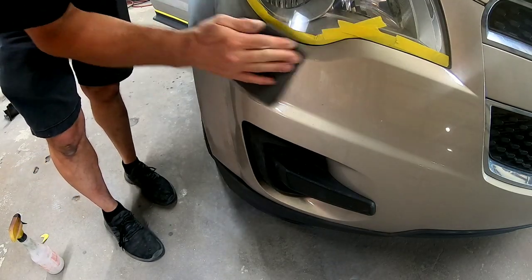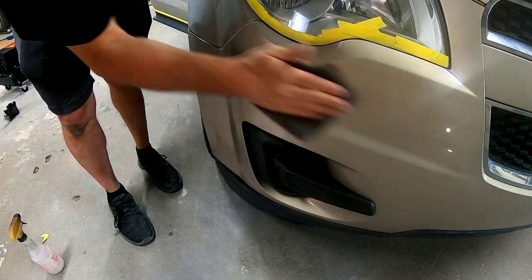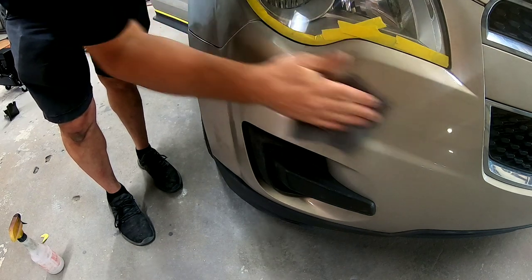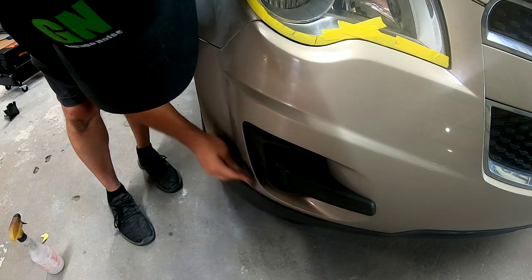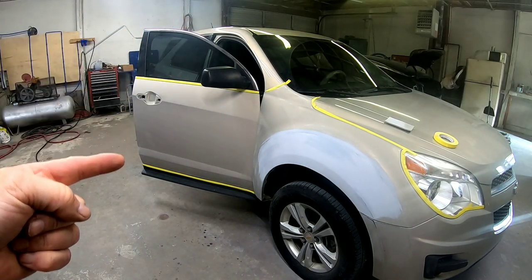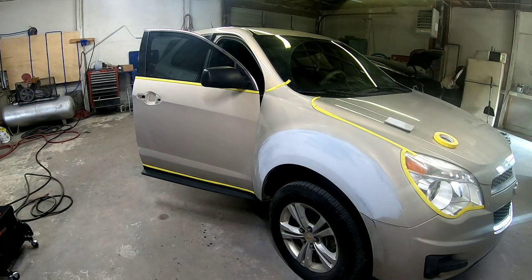Now I'm preparing this bumper for the clear coat blend. I've sanded the edge with 600 grit — that's where we want to do the paint-to-clear blend. The rest of it I want to sand with 1500 grit, and that's where we're going to end the clear coat. Then we'll wash it in with some reducer. Now it's time to mask it off for paint — we'll start by masking off the open door, putting a piece of tape on the back edge of the door and shutting it, then tape up the rest and run plastic over it.